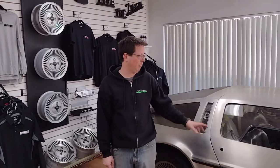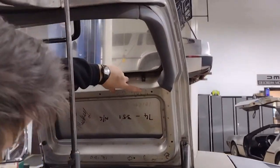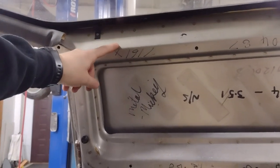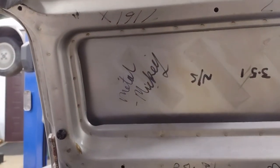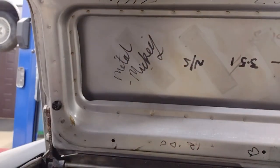We talked about the writing in the headliner — the 'cave drawings.' I have one in the shop that's one of my favorites. The VIN is 10487, and if you look down here the plate reads 10487, and then this is your key code — a four digit code, 7161. With this code, Texas can also cut you a key. The X is on every car, but 7161 is your key code. This is also a signature of Metal Mickey, who signed quite a few cars — I've seen this signature on more headliner cave writings than anyone else.